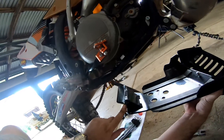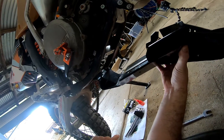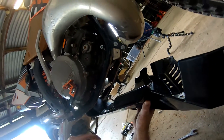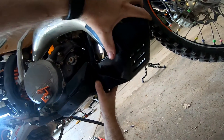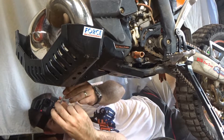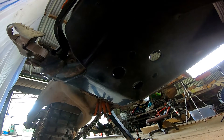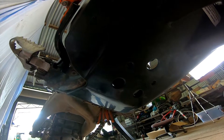Now it's time to fit the bash plate. This curved tab here fits up and over the back frame — slide it up in there like that. Then we lift it up in place and start doing that front bolt up, lining it up with the bracket already mounted to the bike. Wow, that lined up really easily — very surprised, that's great! Next are these two mounting bolts — we'll put thread lock on those and mount them into these two holes. They've got little slots so you can move the mount into the right spot. Very handy.